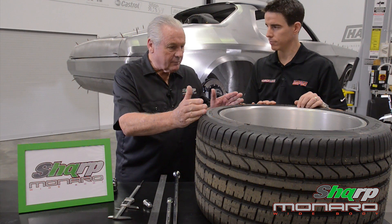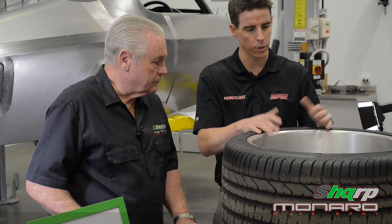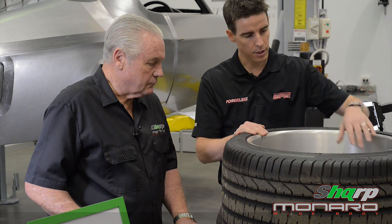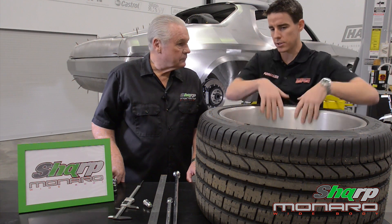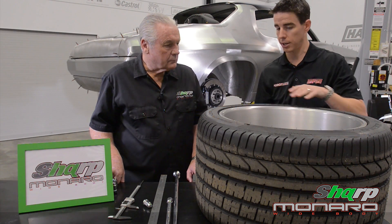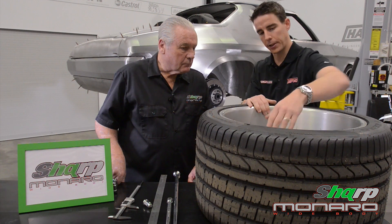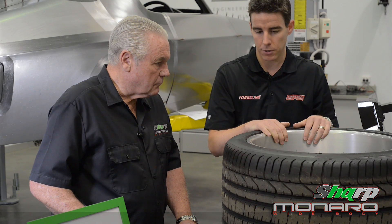Having looked at the measurements, here is Peter's finished wheel. Peter's got a fantastic colour combination, but let's firstly look at the measurements. We went with a 19-inch diameter, enabling high-performance tyres like those seen on European supercars — specifically a 355 Pirelli. With the wide body and brake position measurements, Peter's got a 7-inch outer front shell, giving an incredibly sexy deep dish with a brushed aluminium clear coat, and then a 5-inch inner half. Overall it's 13 inches wide, 19 inches in diameter. It uses the ZX3P centre, which is forged 6061 T6 aluminium — a premier style wheel with a flat lip on the outer and a reverse step lip on the inside. It complements the car beautifully and Peter is absolutely thrilled with the finish.